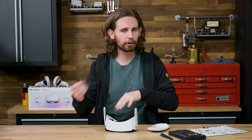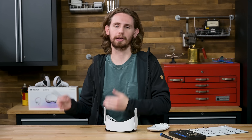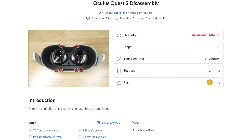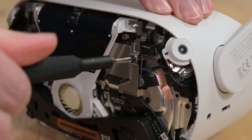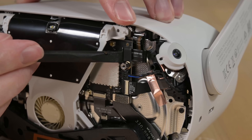Not being able to quickly replace the battery is a bummer, because like everything else with a battery, this will eventually need a replacement. Thankfully, you can at least use it while it's plugged in. Thanks to a user-created iFixit guide, I do actually know where the battery cable is. To disconnect the battery, I just have to remove these three screws and this metal bracket, then disconnect this cable here.